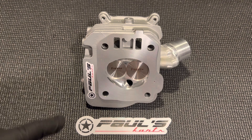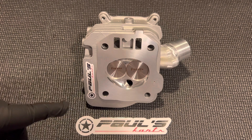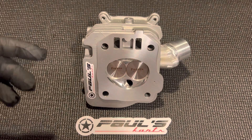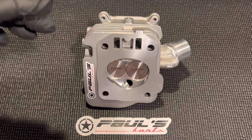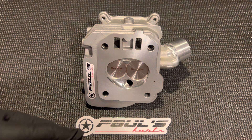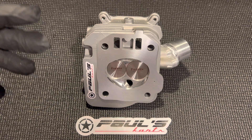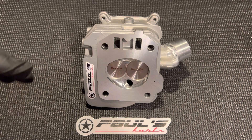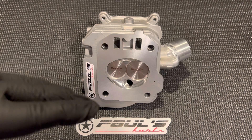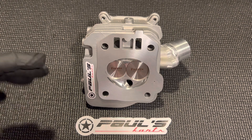Goose, this is your engine. You can get this cylinder head on the site — you can add titanium valves to the cart, and under shop service you can click assembly. You can add max porting under shop service, so you can build this cylinder head through the website just like this. It's got the spring upgrade, the epoxy port, max porting, and the second half of max porting that we don't even really have on the site — furthering the epoxy beyond the regular epoxy port. It's completely recontoured, with copper seats, titanium valves, titanium retainers, dual coil 60 red stripe springs — just perfectly hit for the numbers.